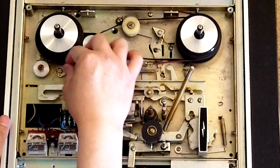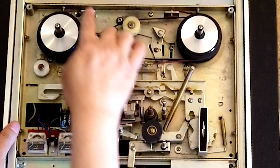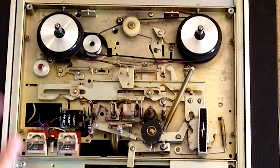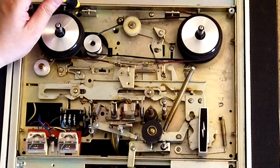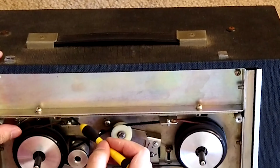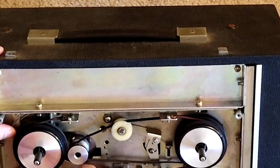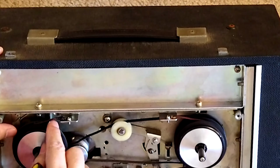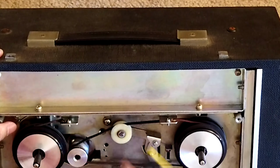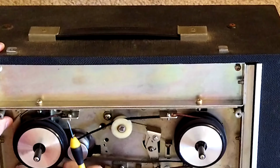Also, by the way, the brake wire, right, is adjusted by these 2 metal pieces, and the adjustment screw is actually inside right here. One side inside here, another one inside here. Let me see if you can see it. So here, this screw can loosen and move this left and right to adjust the wire to make it tighter or looser. It's the same as this screw inside that is also used to adjust the tightness of this brake wire.